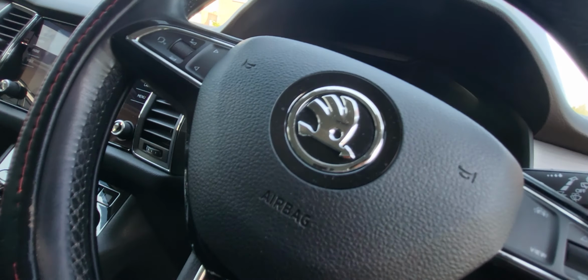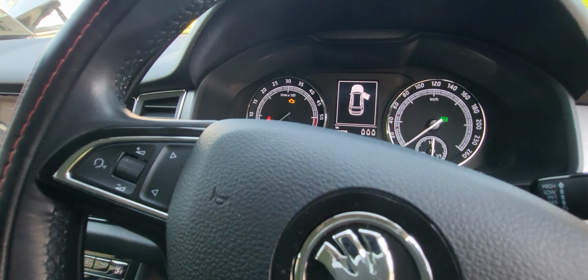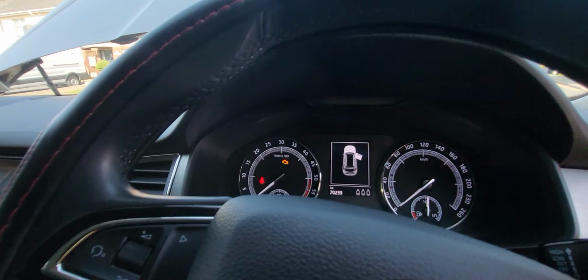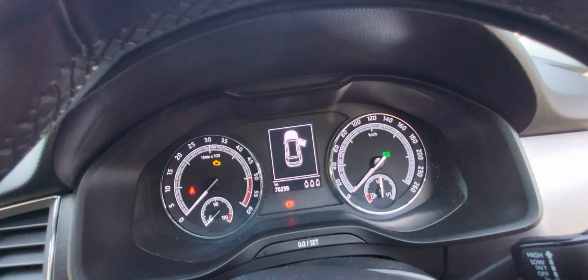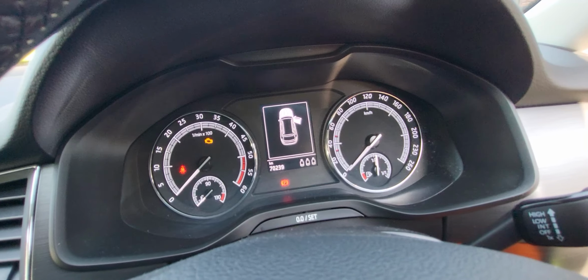Modern engines don't need to be bled, no? You just start it in the second position, and then the fuel pump will be the one to pump fuel to the fuel filter, and then we're gonna start the engine. So press the brake pedal and then start the ignition. Beforehand we're gonna open the system so the fuel pump will pressurize the fuel through the high pressure pump. Stop.